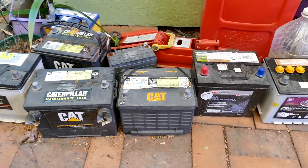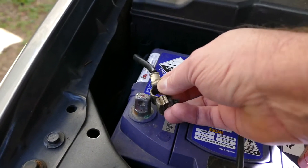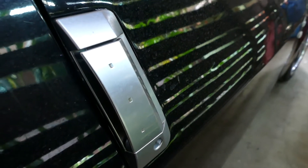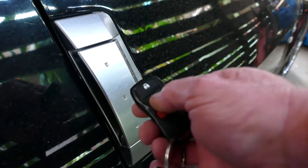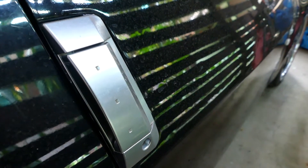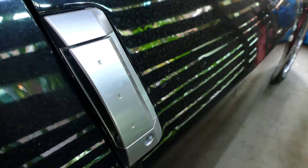Your car battery is constantly discharging or going flat, albeit slowly, and this constant battery drain is primarily caused by things like your alarm system, which is constantly drawing power from your battery. Also things like central door locking are in a constant state of standby, just ready for that signal from your key fob to open the doors. So that also drains the battery.